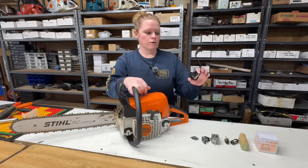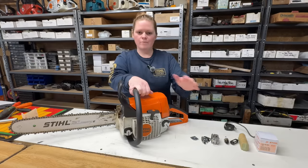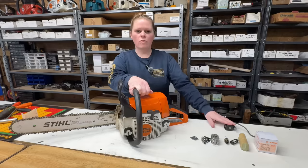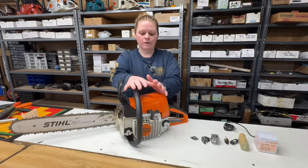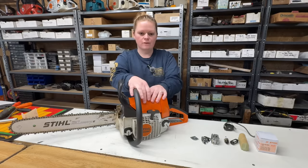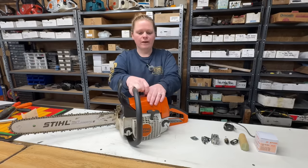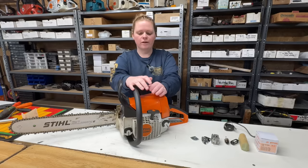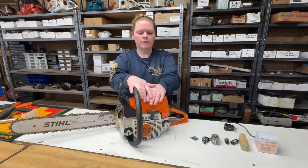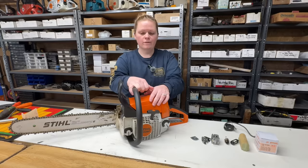I have a good used test coil here, so I put that coil on it, went out — no change. I came back in knowing the coil's not the issue. I thought, what on earth is going on with this chainsaw? So I decided to go back to basics and start over again. I did a full pressure vac test — the saw is tight, tank tested fine. I had Tyler start the saw a couple of times last night and even on his no-choke starts I noticed smoke, like too much smoke.